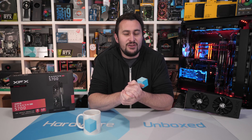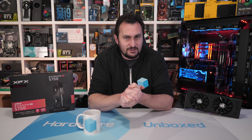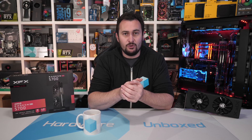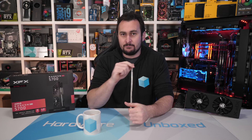It's a bit of a tough sell. Many of you pointed out in the comments that it would probably be worth the asking price if you flashed it with a 5700 XT BIOS, as that apparently gives you XT-like performance while saving you at least $50 compared to the equivalent 5700 XT Red Devil. So I thought we'd flash a 5700 to a 5700 XT BIOS and look at how that performs and what the advantages or disadvantages might be.